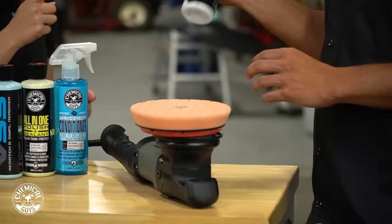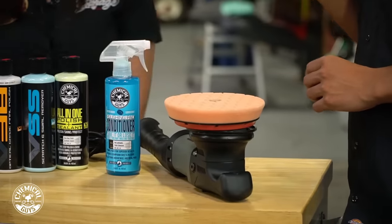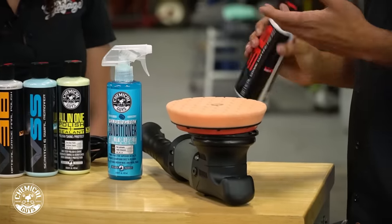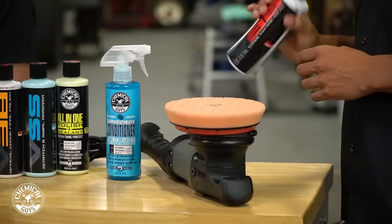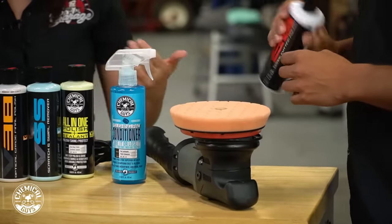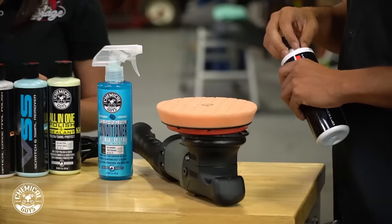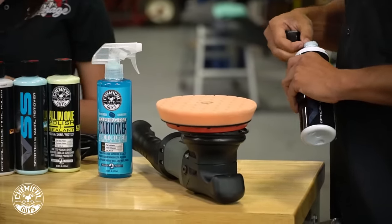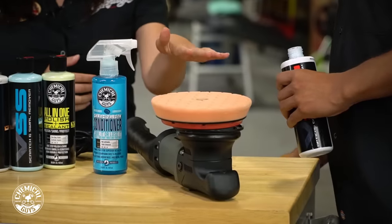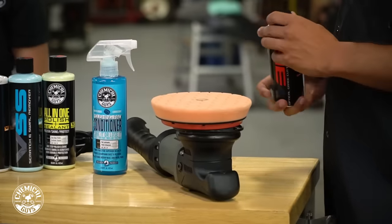So also, the other question that we're talking about, pad conditioner. Pad conditioner is used to make sure that your pad doesn't get hot. It's basically the gist of it. So you want to make sure it's lubricated or moisturized, whichever word you want to use for it, while you're polishing. Again, it's reducing the heat friction. These are machines, so they are producing heat and cutting through this world of scratches. So that's why we spray it a few times before we start, and then we spray it sometimes in between polishing, and that's what you've seen in other videos.